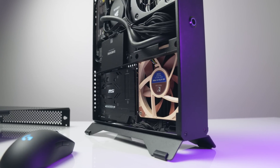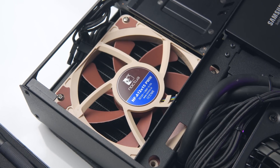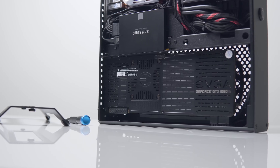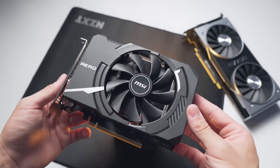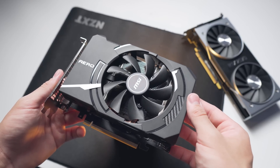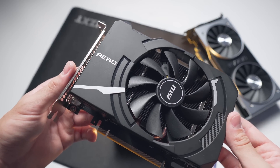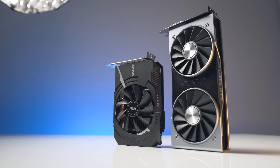The most important thing you need to know for this configuration is that you will need to compromise a little on the graphics card. The 120mm radiator occupies an area right next to your GPU, so whereas before the Sentry could accommodate a full-length card, you're now restricted to just 175 millimeters in length. That said, you can still accommodate up to an RTX 2070, like the MSI Aero ITX we'll be using today — it just means no full-length dual-slot RTX 2080s or 2080 Ti's.